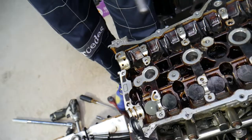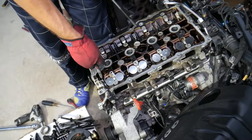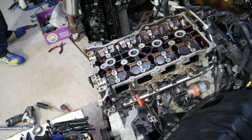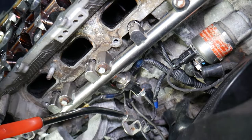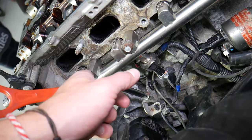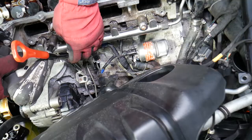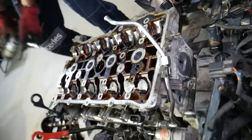The last two bolts have separate washers on the very left side — the other bolts have washers pressed onto the bolt. Don't forget those separate washers. With all bolts out, the cylinder head should be loose. Before lifting it, check that nothing else is holding it. We forgot to disconnect the fuel injectors and fuel rail pressure sensor — remove the whole fuel rail assembly, which is just three bolts. Be prepared for leaking fuel — always have a fire extinguisher nearby.